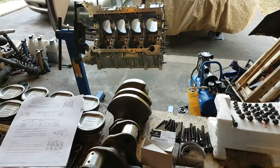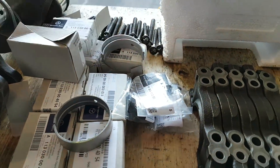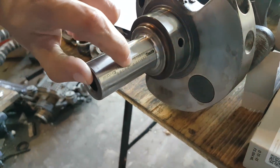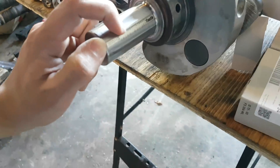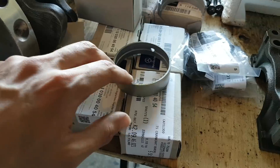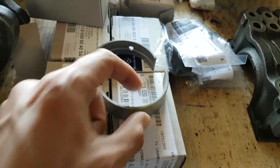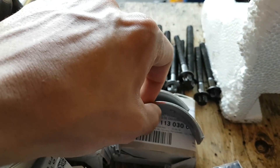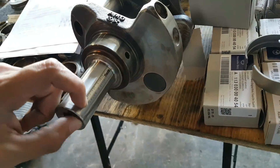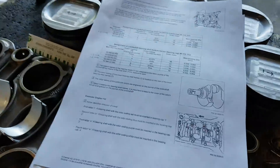Now I have to figure out where the colors go for all these bearings. From part one I briefly mentioned the colors printed on the end of the crankshaft that refer to colors of the bearings. The colors are actually an anodizing or paint on the end of the bearings that refers to a certain thickness — yellow would be one thickness, red another. For the clearances to match perfectly you have to put them in this sequence. G-R-G-R-R — G refers to yellow, it's in German — and there's a document in the service manual that tells you all this, titled 'Install Gauge Crankshaft Bearings.'